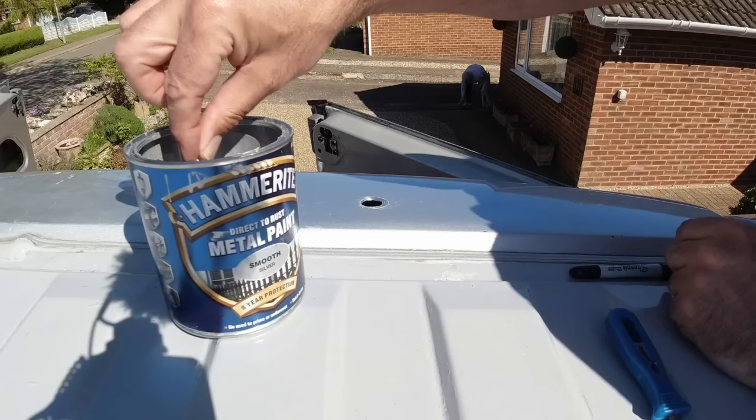And then lastly, once I've connected these two positives together onto this connector, I'm going to put an inline fuse. It's a Renogy 30 amp solar fuse, and we'll plug that onto there, and then we'll plug our positive cable onto there, and that'll fuse that connection, make it safe coming down into the van.